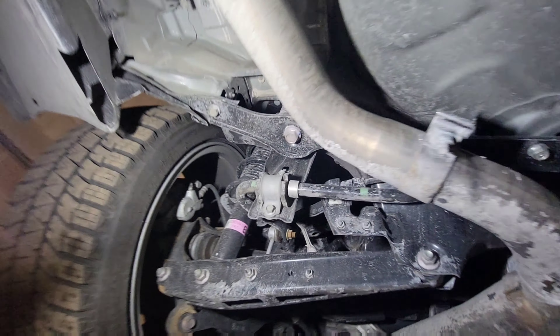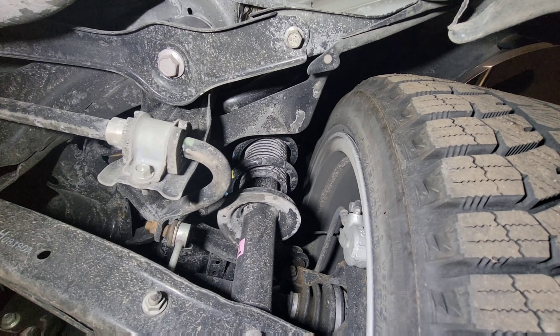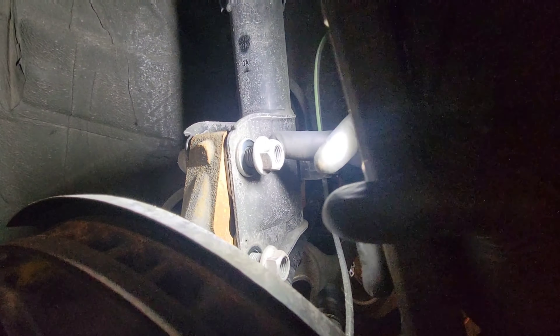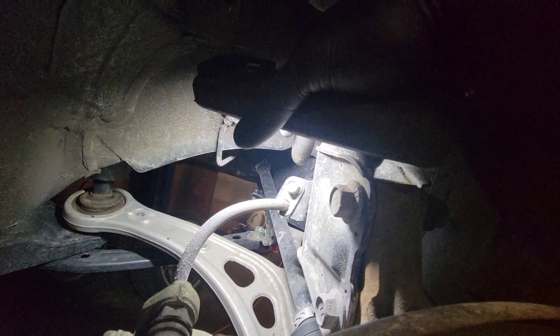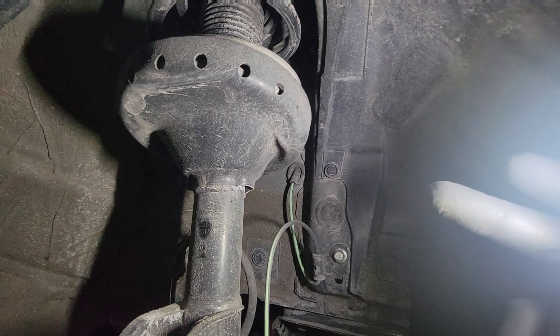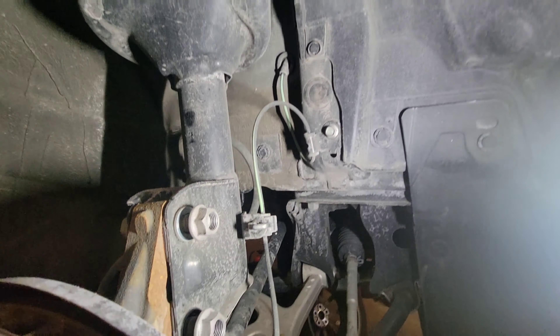Time to swap out factory suspension — time for you to go under the knife. Step one: remove the wheel. Step two: come over here and start removing the big bolts for the strut assembly. You're gonna have to take off the brake line bracket — probably 12 or 14 mil — and then disconnect the wire for the ABS harness. After you do that, it can pretty much hang free until you're ready to go up top. I like to get all my suspension loose and then bring it down — everything on the bottom, then everything on the top. Once you've got everything disconnected, you can just let the suspension hang free.